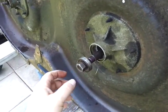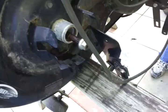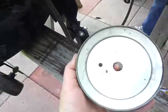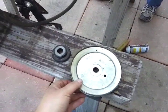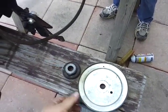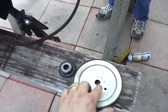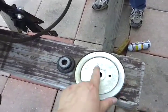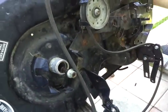Once that's done, you can go ahead and remove the nuts and the whole shaft will come out. Notice there's a difference in the shaft — one side has a fine spline and this side has a coarse spline, which corresponds to the coarse spline in your pulley. The splines are important so that when the blades are cutting and hitting, they don't strip out and cause the belt to slip. If the splines are stripped out on yours, think about getting a replacement pulley — that part number is 94199. We're going to take a short break and I'll get the other blade and other bearings and show you the installation on those.